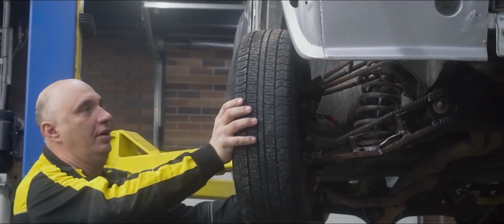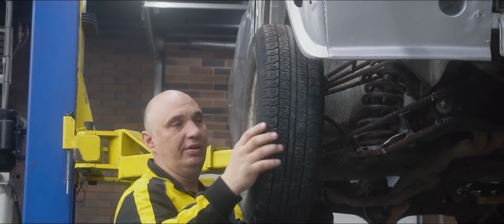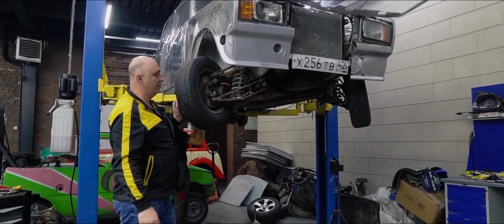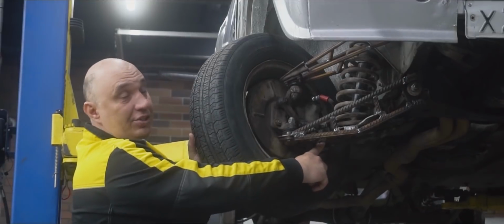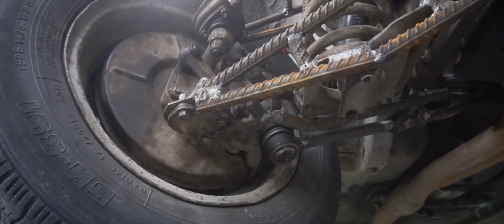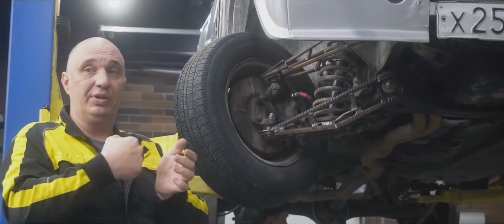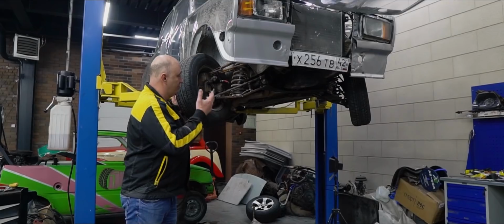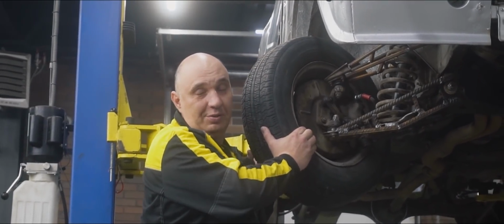Let me show you something. The wheels are on straight. Looking from over here, you don't see them angled in either direction. Well, maybe there's a slight misalignment. And look at how much steering angle we got. And all because of the tie rod end. Now, you remember me showing you that recess on the lower arm earlier in the video, right? The point is that it moves into that space now. That's where there would have been interference with the stock arm. And that's what was preventing us from making the steering angle dramatic. But here we've got that recess, so I think it's time to go do some testing. Let's head out.